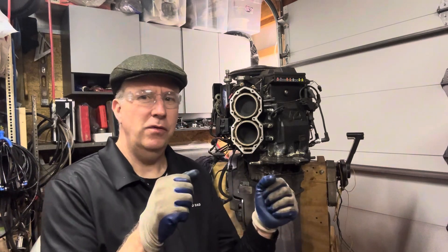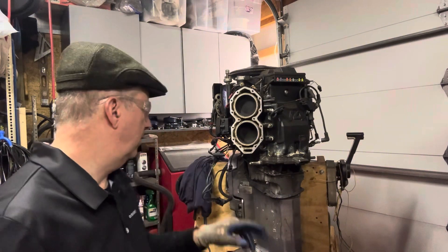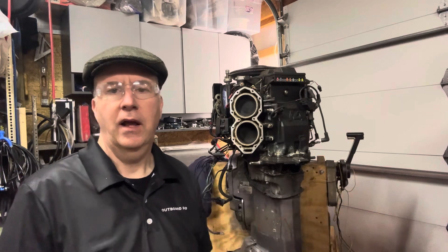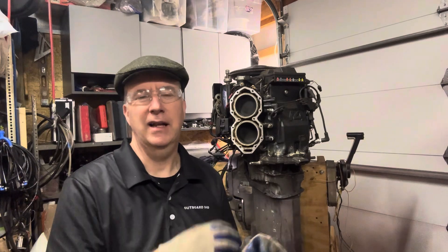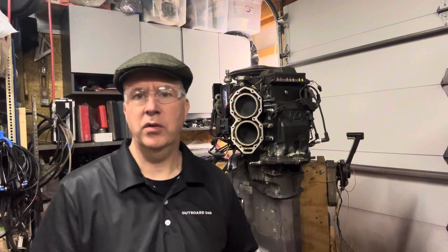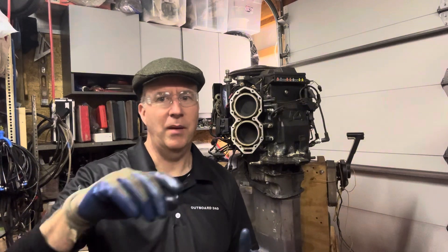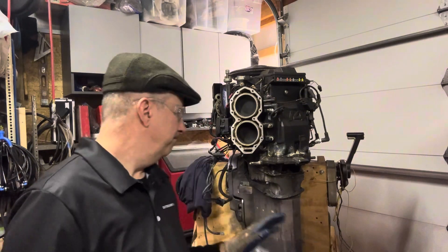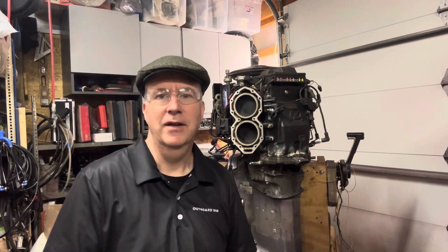We heated it up two, even three times now and it's starting to move. I get the gun on there and it goes a little bit one way, a little bit back the other way. We're going to let it sit, take the rest of the bolts out so that takes some pressure off, and try to get some lube in there. We'll let it completely cool down and try it again — maybe later today. Remember, we did it several times with that Mercury before we got it out. We really don't want to break the bolt off if we don't have to, but that may be what we need to do.